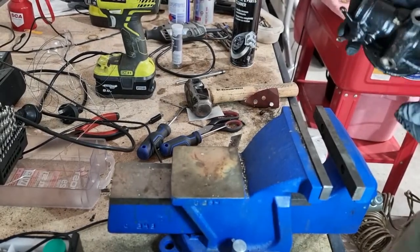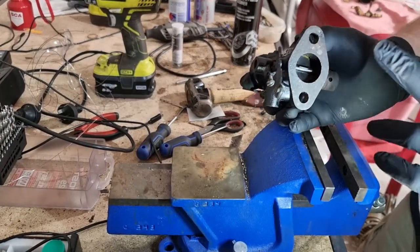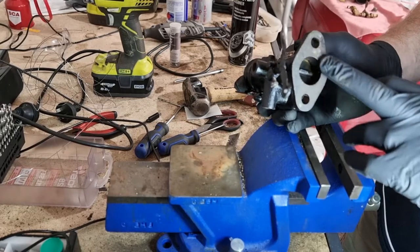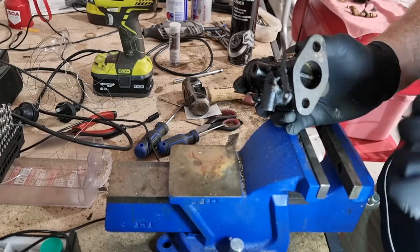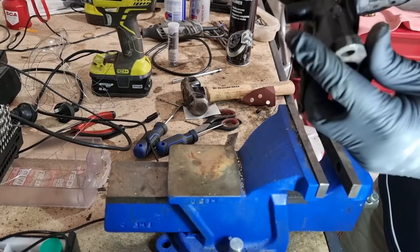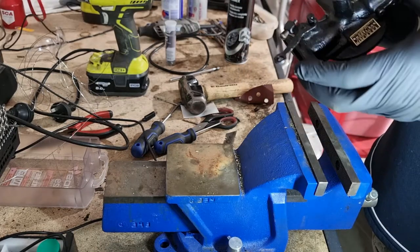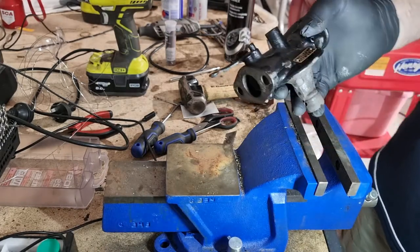Okay, so I finished that job. What I've used is a Permatex fuel tank repair. It's a two-pack steel, called a steel weld, and you get a very nice finish. So the next person, or myself, that wants to do this job again, that's going to drill out really easily. Here's that one done, and this one as well. So all that now remains is to do my little reassembly job. So I'll set you up and we'll crack on with that.